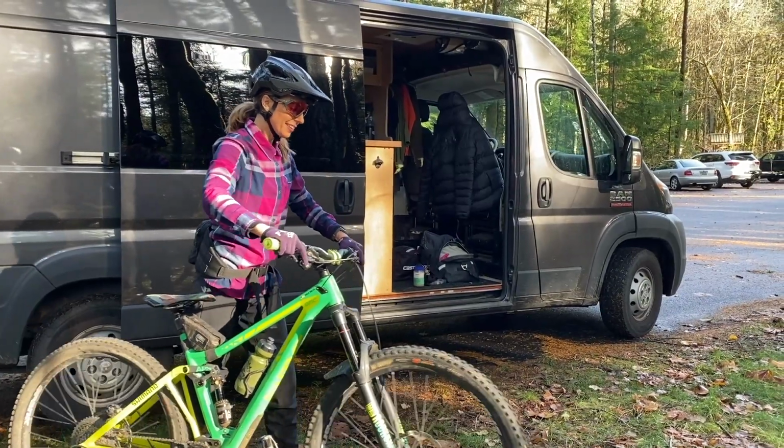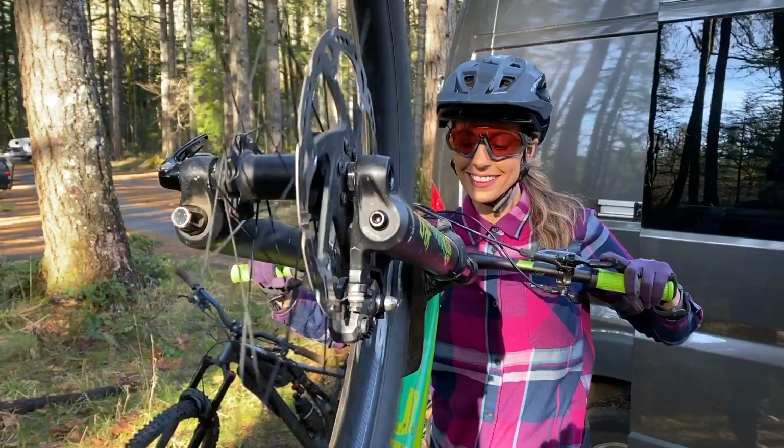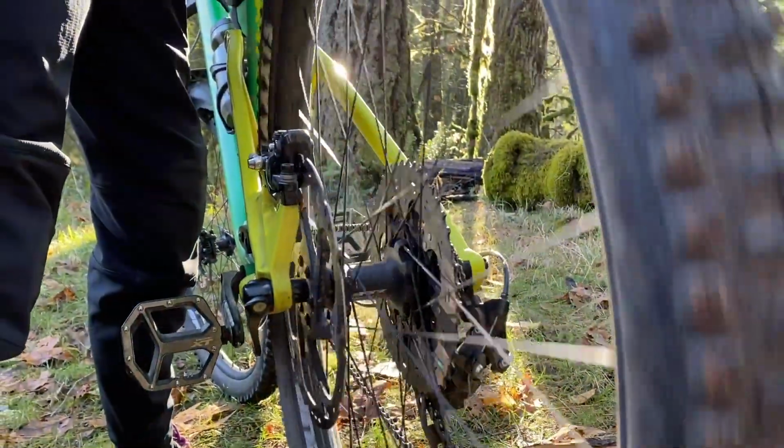Your bars should rotate smoothly without any grinding or binding. Rotor should not contact the brake pads or the caliper. Rims and rotors should spin freely. Inspect hubs for lateral movement, and also repeat this with the crank arms. There should be no side-to-side play whatsoever.